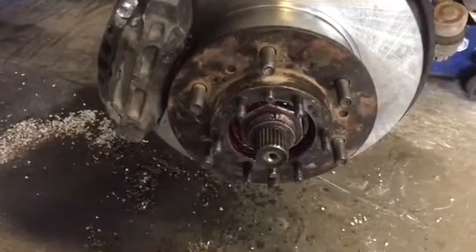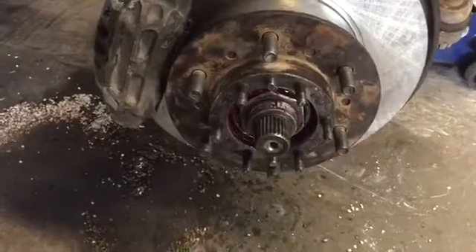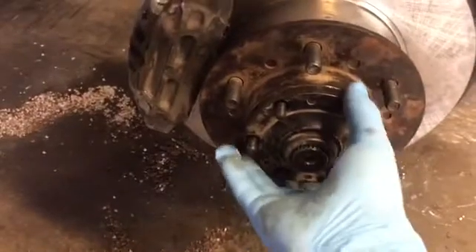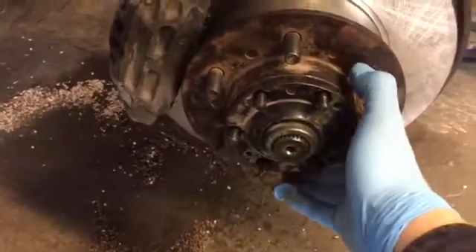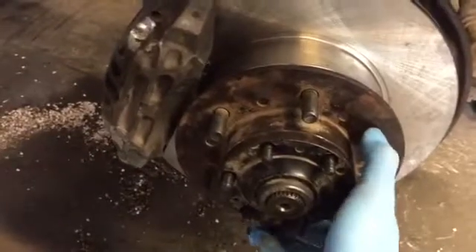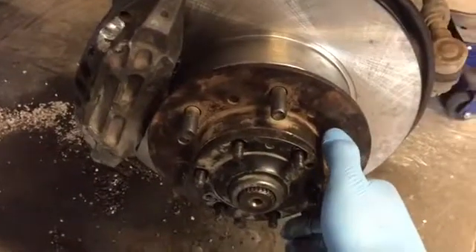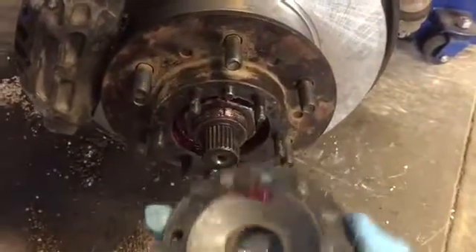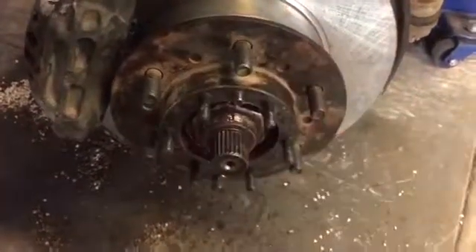Additionally, turning over the viscous couplings in the front differential requires significant force. So if you leave this flange attached and take a reading, it would alter the amount of force being read by your tensiometer. You need to remove this flange in order to get a proper reading on the bearing preload.